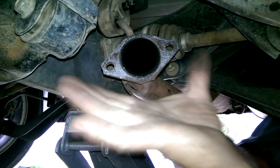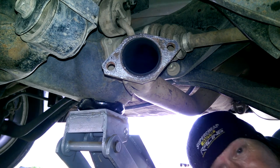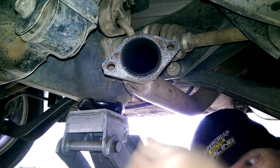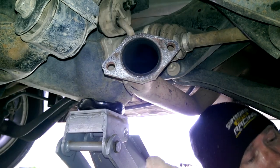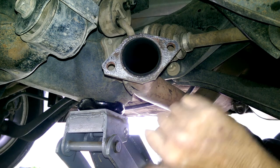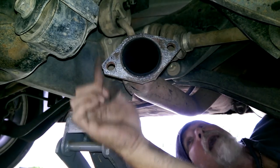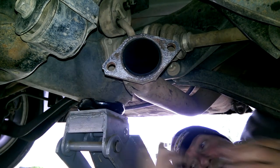Just another point, we've actually had this exhaust out like last week. We had to replace the clutch, so the exhaust had to come out, so all this is loose. When you try this, squirt those with a bit of penetrating fluid, because they will be rusty, they will be bound up, and they will be a lot harder to get off than what you just saw. And as for the hangers, a bit of degreaser, WD-40. Oh look, found that nut.